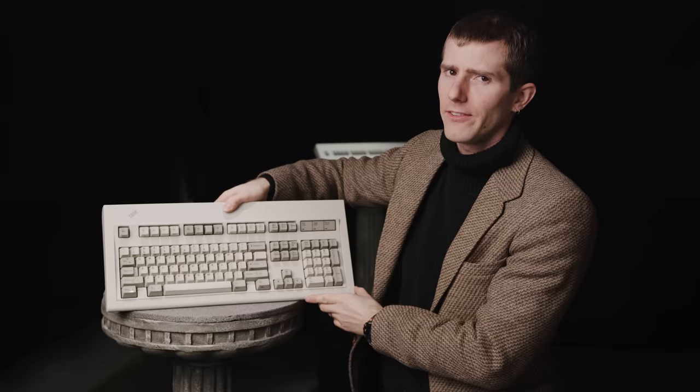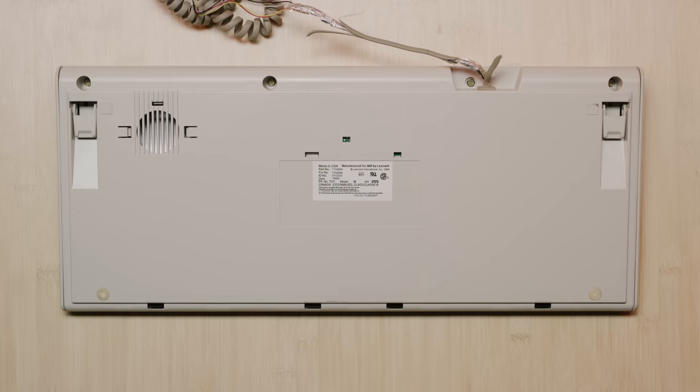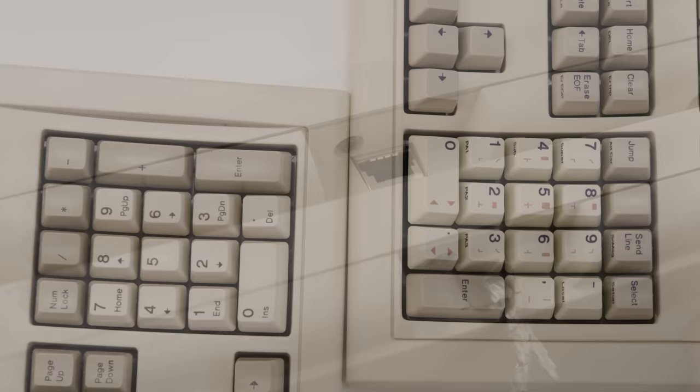At least they were five pounds. Not all Model M's are created equal. In 1990, IBM sold part of its keyboard manufacturing division to what would become Lexmark. Lexmark continued to make these keyboards for IBM, but more cheaply. A Model M from 1995 demonstrates some of the changes, including one good one — drainage holes — along with several less good ones: a lighter backplate and plastic shell, a fixed instead of removable cable, monochrome legends on the keycaps, and rubber dome switches. The growing popularity of rubber domes led to the collapse of the mechanical keyboard business, with Lexmark dropping their keyboard division entirely in 1996.